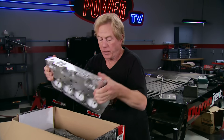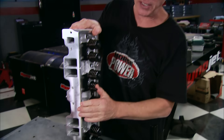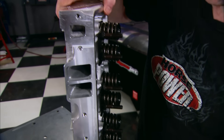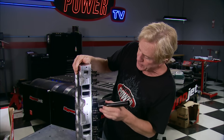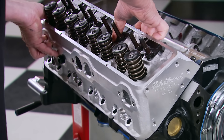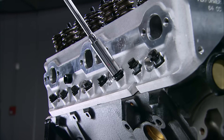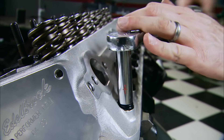There are lots of ways to cut corners when you're budgeting an engine build like ours, but if you want to make some serious power, don't go cheap on your cylinder heads. These aluminum performers go for about $570 a piece, and for that you get features like CNC-machined 185 cc intake runners for better flow, and premium features like bronze valve guides that transfer heat better and resist seizing. With 64 cc combustion chambers, we expect our combination to yield about 10 to 1 compression ratio. No pinching pennies on head bolts, either — these are ARPs with sealant on the threads.